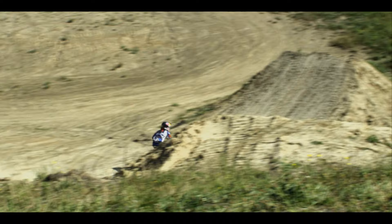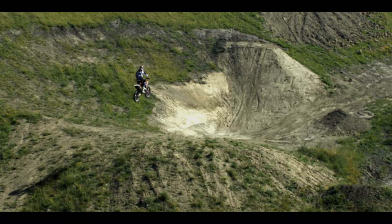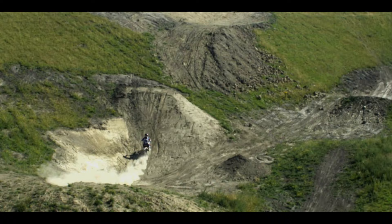I'll put a pipe and silencer on it just to get a little bit more power out of the engine. Do a little bit of tuning with it — we mess around with base gaskets in the head, we adjust timing and compression and whatnot.